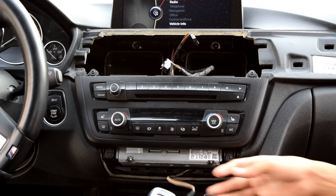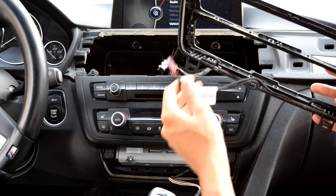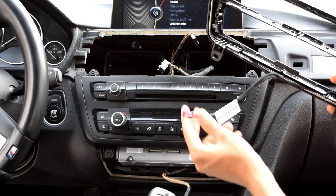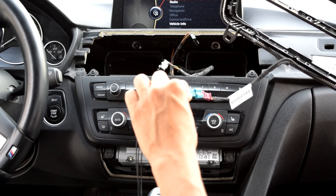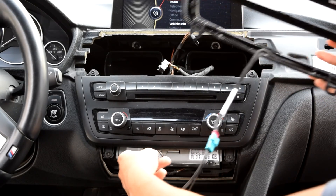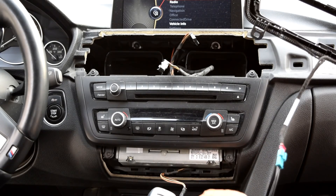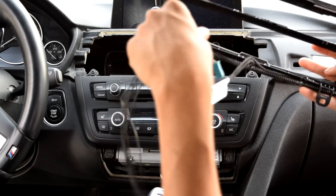Now I have some explaining to do. When you get this new trim piece it basically comes with this plug and that's it — at least the one I got. The one I'll link in the description will come with the cable as well, it'll just be a little more money so you don't have to worry about making the cable like Mike had to. The reason Mike had to make a cable is because this is a male connector and so is this. So in the LCIs they switched it up. What Mike made was a Y cable — female — you plug it in here, this end plugs into this end, and that's what powers it on. The other end plugs into this trim piece which has a light as well. These are all OEM BMW wires, so you have nothing to worry about if you buy from the eBay seller in the description.